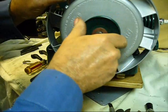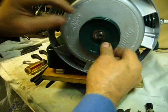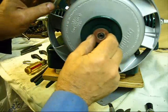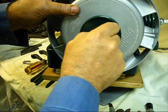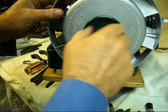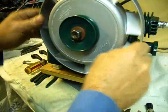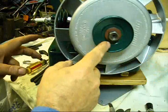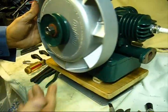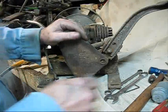And you want to make sure that pulley is indexed. I'll show you. You want to make sure that this pulley is always indexed with that D shape. Hold the pressure on it like that. Don't let it get floppy. And then put your nut on there. And you'll know everything is indexed. All that's left to do is to tighten that up. And once it gets tightened up, then I will touch this up with a small sable brush. Rust-Oleum dark hunter green enamel. It's going to need a lot of it.